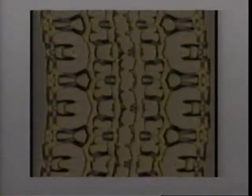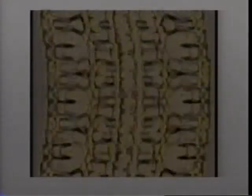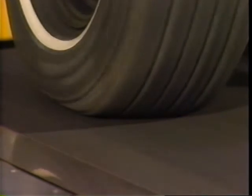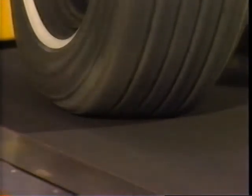Under normal circumstances, this isn't a problem. As the tire rotates, the tread blocks remain relatively stationary. But when a car corners frequently or the toe is incorrect, the tire tread is subjected to a great deal of lateral force, which causes the tread blocks to twist and squirm in an unusual manner. It's this twisting, squirming action of the tread blocks that causes all-season tires to wear in patterns commonly referred to as irregular.